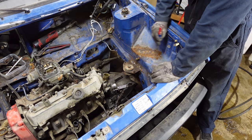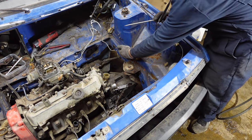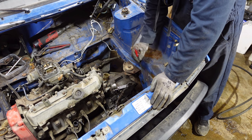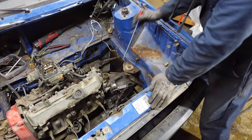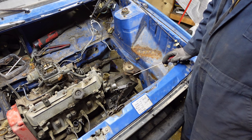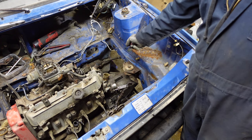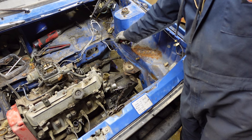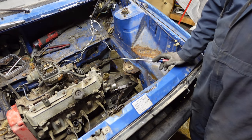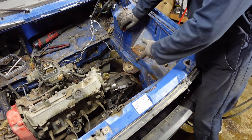This section will be cut out and replaced just because of battery acid leaking all over the place, so I'll be cutting a section here and welding it. There are more spots down here too. Once the battery tray is moved you get more room. Once the engine is in I'll test everything out and then pull it out — then I have to reinforce the whole car. The welds all have to be reinforced, as this car has a tendency to flex a lot.